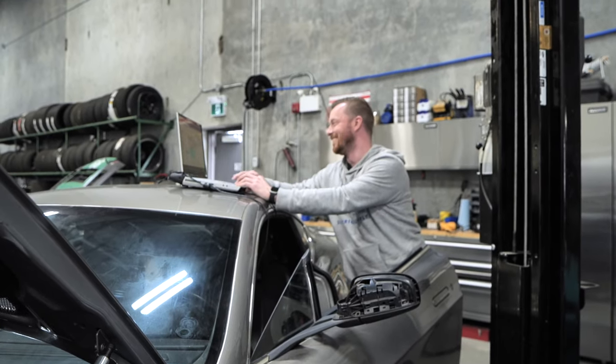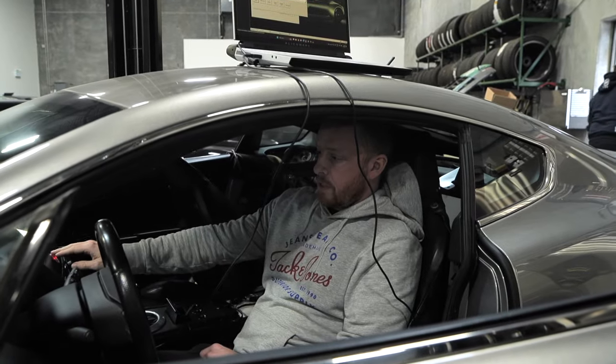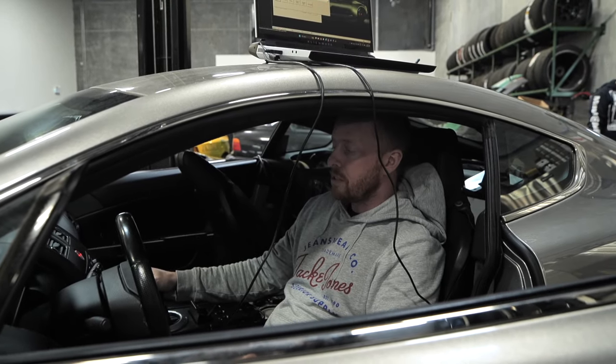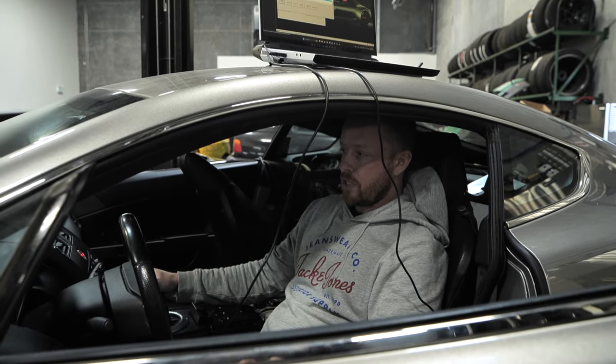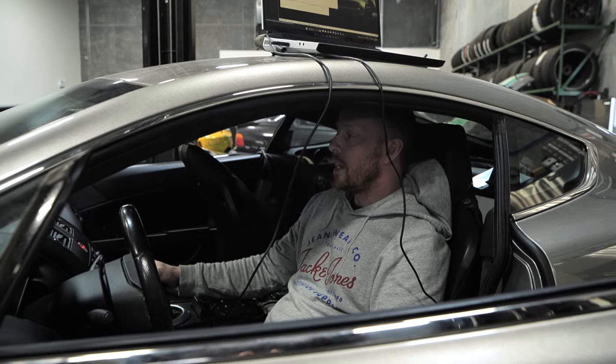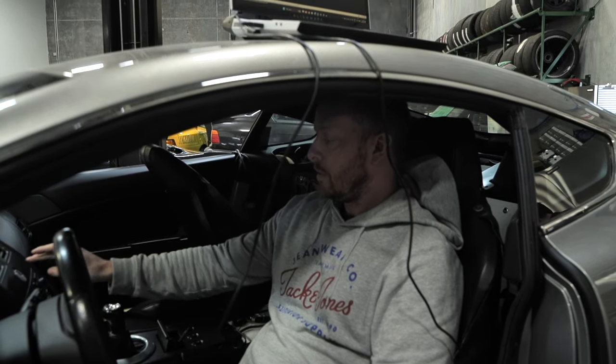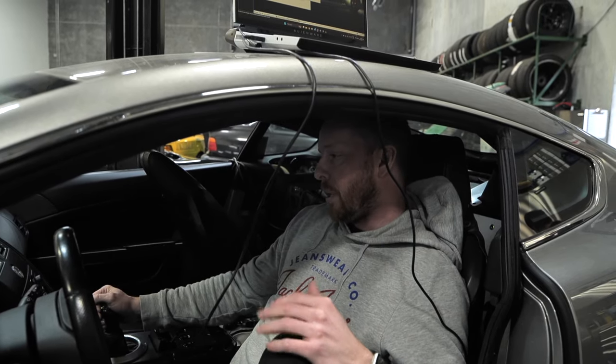Episode five and a half, Project SuperVantage — it runs. So what's going on? Hopefully this is an easy fix. It runs now. All we had to do is disable EGR and disable secondary air — the file didn't have it done. I had to look and see what was done in it. We also had MAP sensor issues, and on this engine the MAP sensor is actually related to the EGR. So we just had to disable the codes for that for now, and code it out later more in depth. She runs — idles, revs. Right now it's good. There are no misfire corrections learned, so the fuel isn't cutting like it should, but right now it's working.